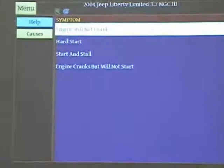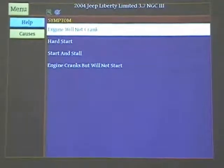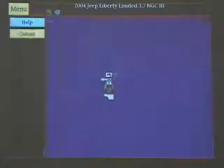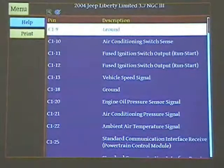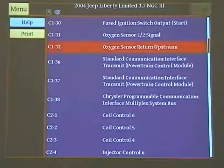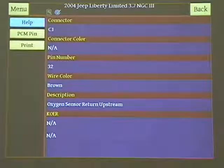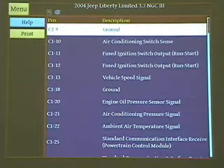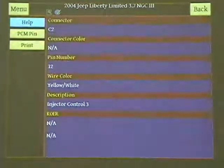Let's look at symptom. For a particular model year, you might say engine will not crank. Notice I'm clicking on all of these here — it doesn't work. Sometimes it's just not in there for this vehicle, and I'm showing you the real deal. It doesn't mean all parts don't work. Now let's look at the breakout box section — let's say you were looking for the oxygen sensor upstream return. It tells us the connector number, the pin, wire color, and description. Let's look at an ignition coil — it tells you that information too. That is a big help when you're working on a vehicle.